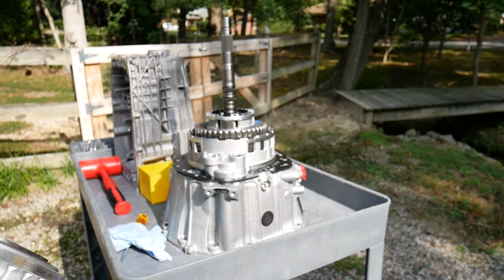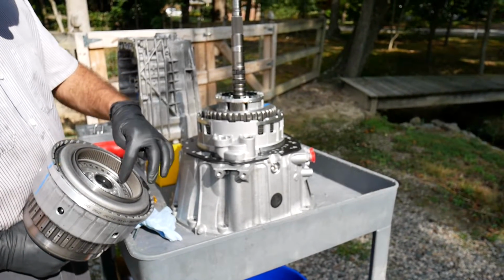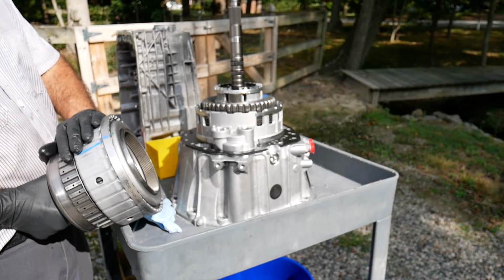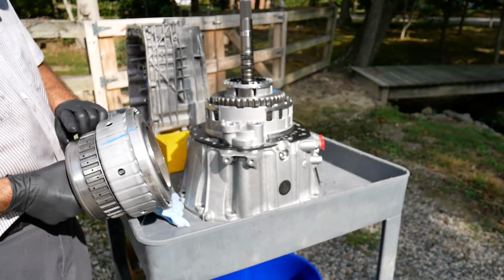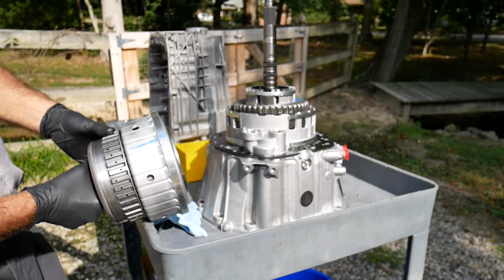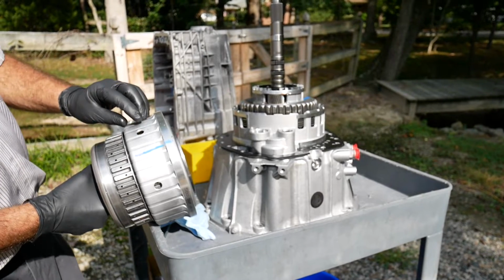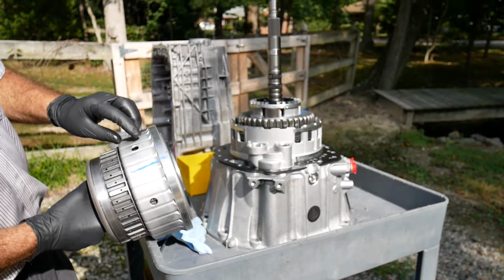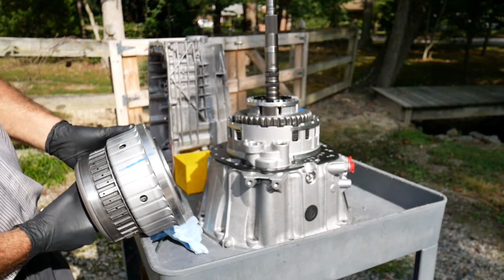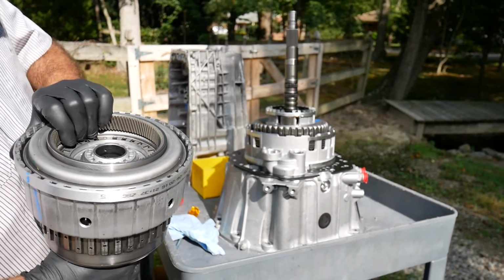And here we're ready to install the P1 internal gear. P1 planetary actually splines to the P2 internal gear, internal within this assembly. P2 sun gear can either be locked to the case or allowed to turn freely via one of the disc brake clutches. We have a disc driving clutch that's within this assembly that will of course be talked about and shown during a component rebuild. This is an assembly.